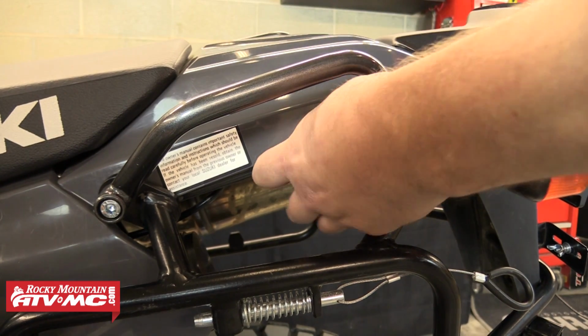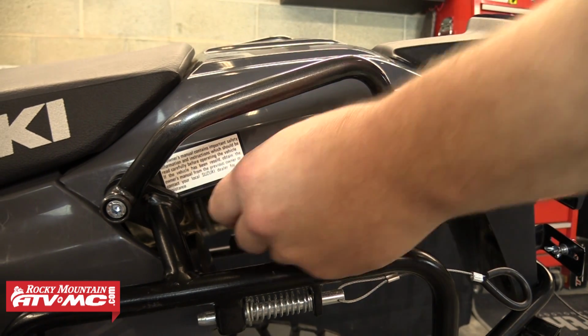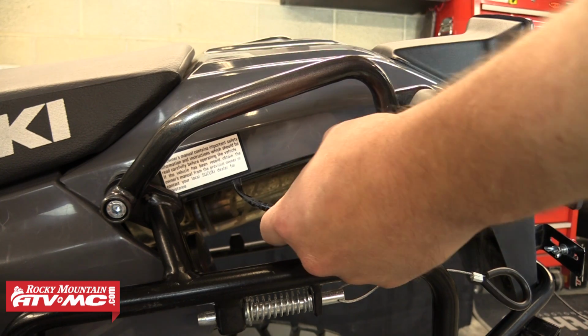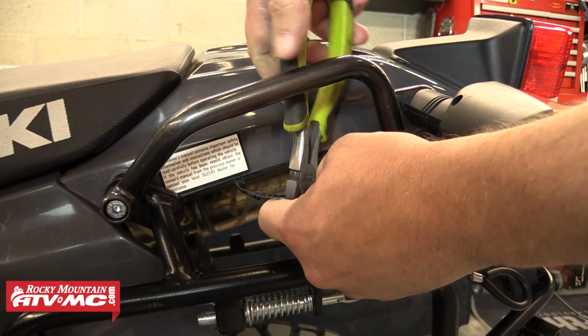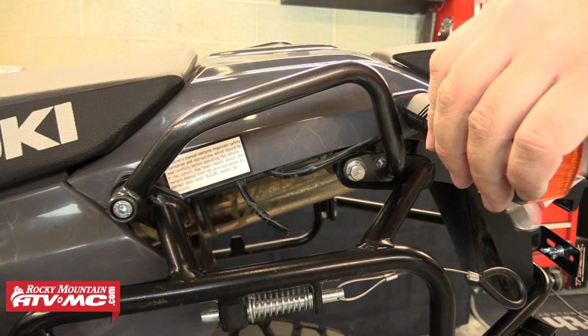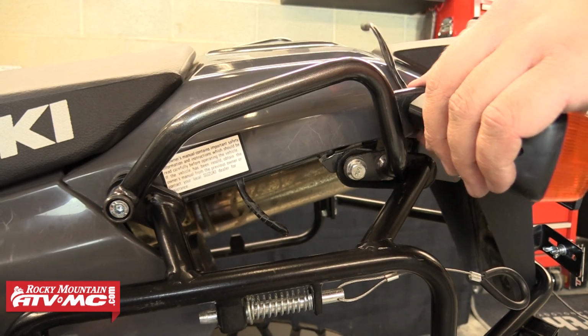Now to start this, we will locate the blinker wire running from the turn signal, then pull it out from under the fender. Once that's done, we will cut the blinker wire approximately 2 inches out from the fender. Now we can unthread the nut on the back of the grab handle and slide out the wire while supporting the turn signal.